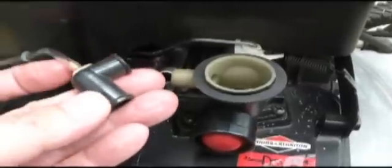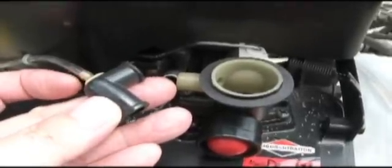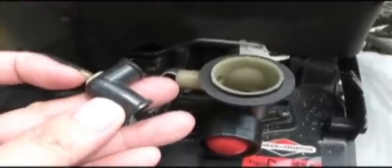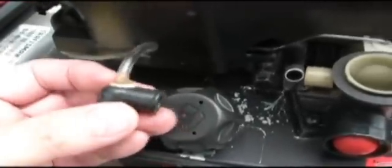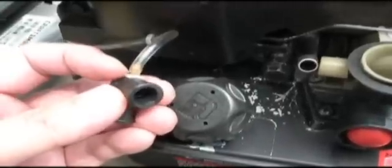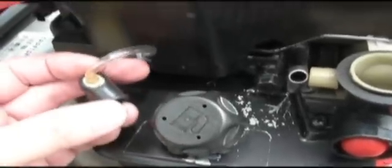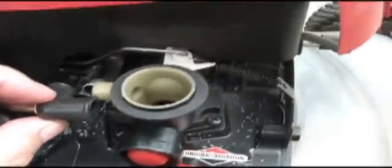The one little minor modification that I made on this lawn mower is just to add a one-eighth inch male-to-male tubing connector. I used a sharp tool to punch a hole into the side of this rubber elbow, stuck that male-to-male connector in there, and used some urethane glue to seal around it. I just had to hold it firmly without moving while the glue dried overnight, and it makes a nice seal — a pretty good, straightforward entrance for the propane to go directly into the carburetor.